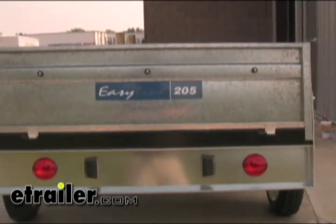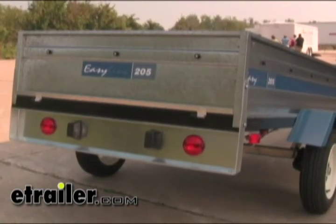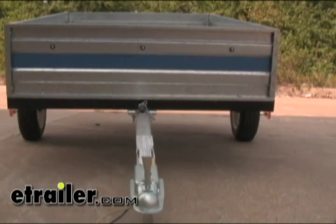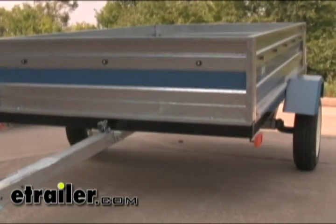The same tricks apply to check and make sure your lights are working. The connection to the light could be bad, or it could be a smashed wire underneath the frame of the trailer, or up front where you've got a little bit of road rash dragging the ground. We'll go ahead and show you an example of that type of wiring on a different trailer.